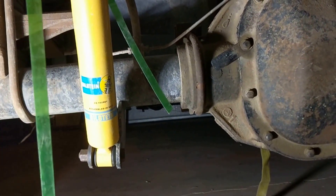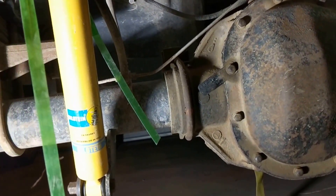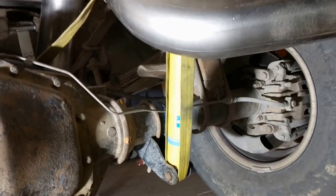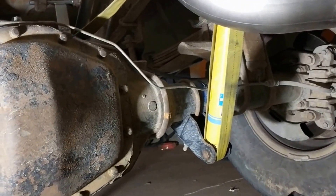Make sure that when you loosen it up on the bottom mounting on the front, you turn the bolt, not the nut, or you're going to break it. These tips are for Bilstein 4600 shocks on a 1999 F-250 Super Duty 7.3 diesel. Good luck with your project.